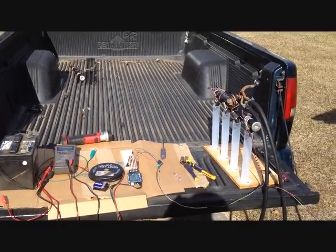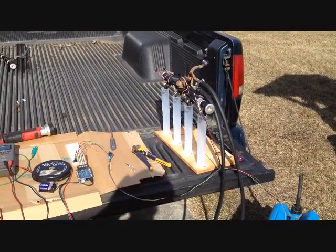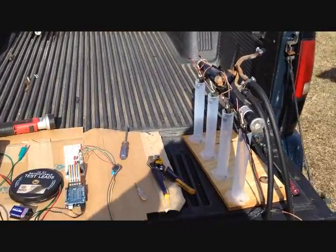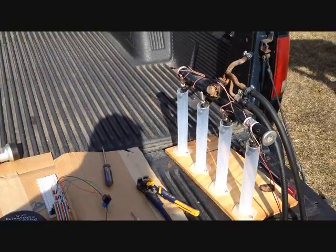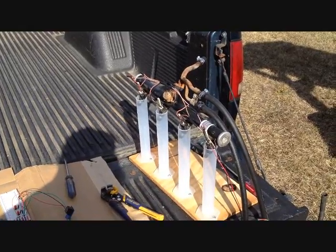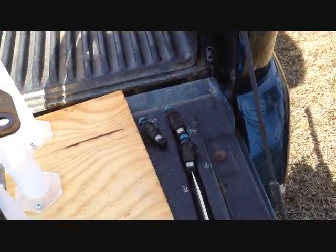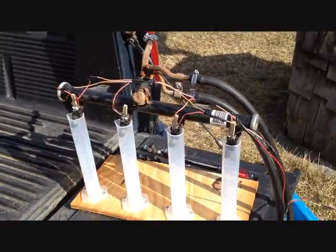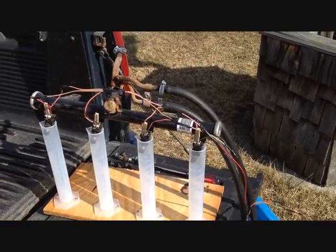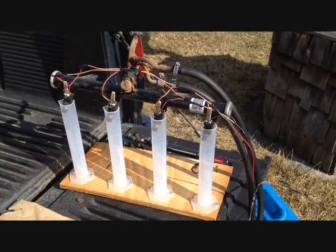Static flow test, round two. First time I tried testing it, I found out I had one leaky fuel injector and the leaky fuel injector was the only one that actually worked. I took and made sure all my wiring was correct using my voltmeter, and everything's got perfect continuity where it's supposed to be. So it's literally the injectors — they must be frozen up. I pulled the three bad ones for now and left the leaky one in there. I'm just taking my chances seeing if any of these other three are good. If this doesn't work, I might end up yanking the injectors out of my Firebird because I want to check them anyway, and I know they work.